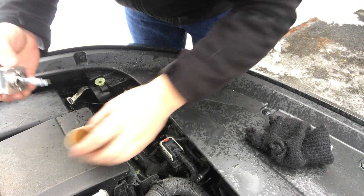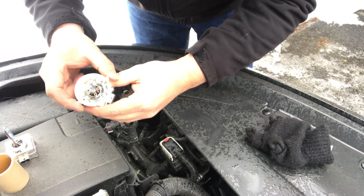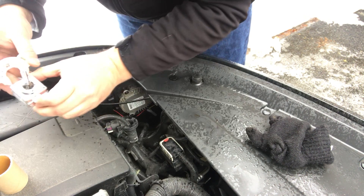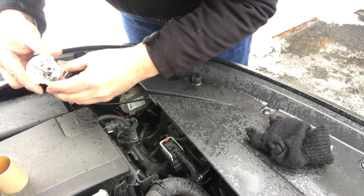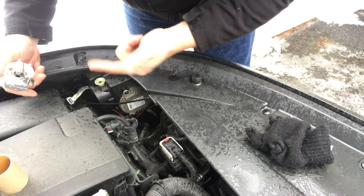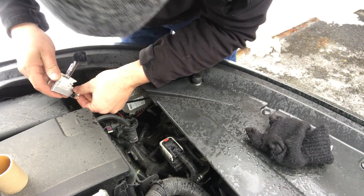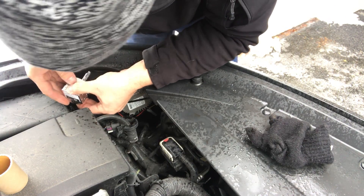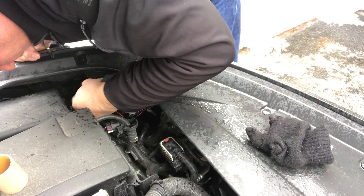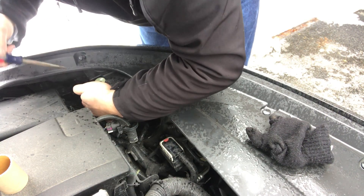The trick is you can't touch that end of the bulb or you'll ruin it. This little plastic piece here comes off, so you just slide that piece off. The old bulb and everything can go in the trash. You put this plastic piece back on the new bulb, reset it back up into position — it is a little tough to get in there, so I'll use a little screwdriver to pry it down. Then plug it back into the outlet and slowly bring it right back into that hole, being careful not to break it.